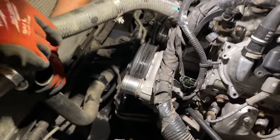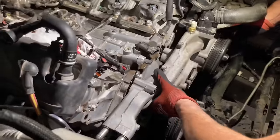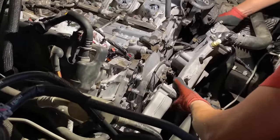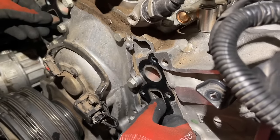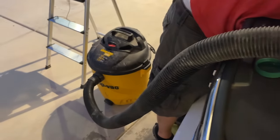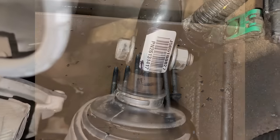Take off the lower hose and now we can remove the water pump — watch out for hidden bolts, follow the water pump all the way around. On the side of the water pump there's also a bracket that was keeping it from coming out. Here's what the water pump looks like — it has two gaskets on the front that come right off. We used a shop vac to get as much coolant out as we could; we don't want any going into the cylinder heads.